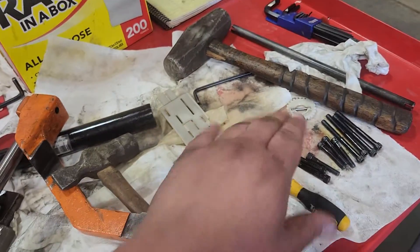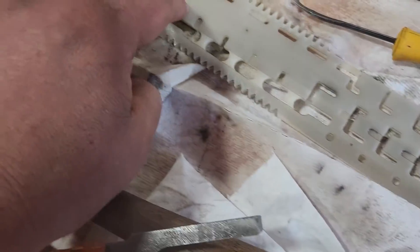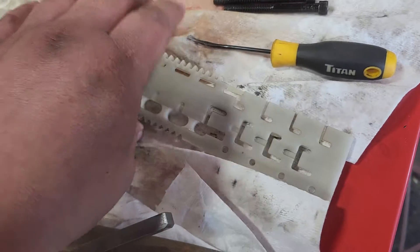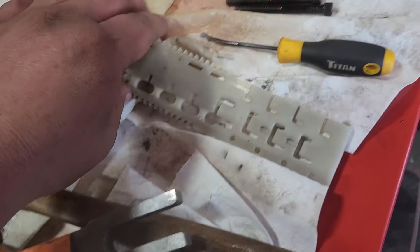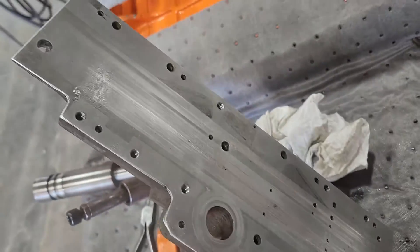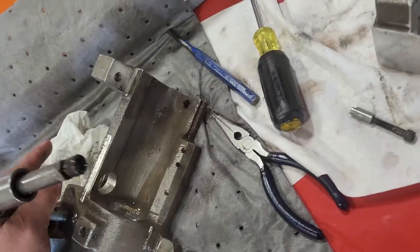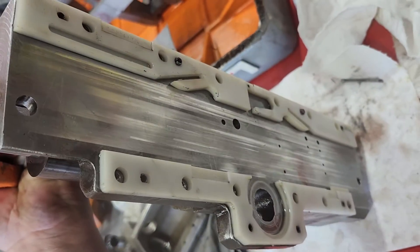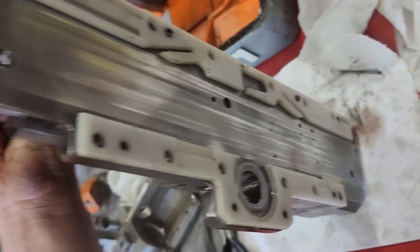As you get it apart, just set those to the side. This can either be scratched — mine's in pretty good shape — but you're going to see some major gouging in there if this is the issue. Or this can break. This nylon heats up and breaks. So you want to inspect this and the two valve bodies on the inside. Look at that and make sure it's not scratched. You'll see all those nylon parts — just make sure that all that's in contact and you're not going to have any problems there.